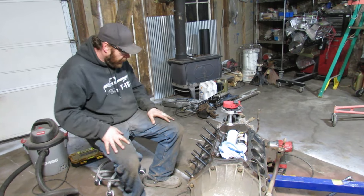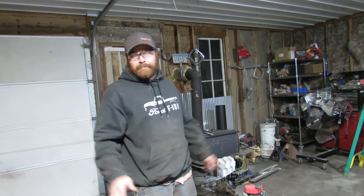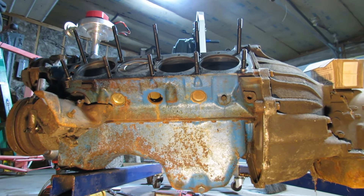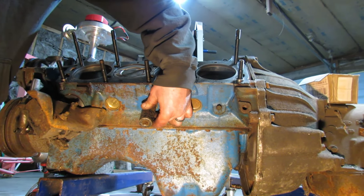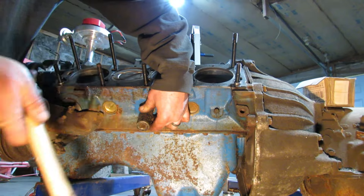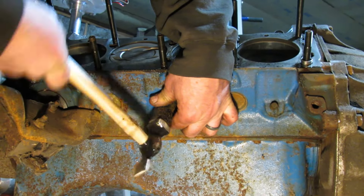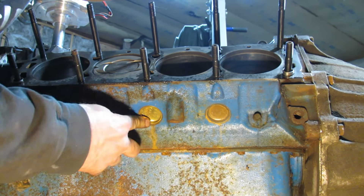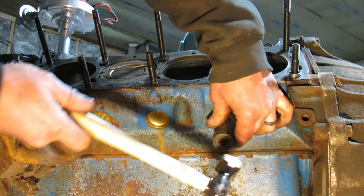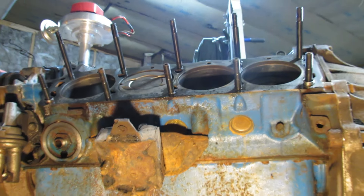I'm going to go throw the other side head studs on. You'll see me in about 0.2 seconds on film but it'll actually be tomorrow. Well, it is the same night — forgot I had another frost plug to put in, the block plug dirt clean-out plug. I just find a socket that's almost the right size and tap it in about flush with the taper part of the block. Once it starts going in, you call it good. Already got the other side done, so I don't have to worry about that.